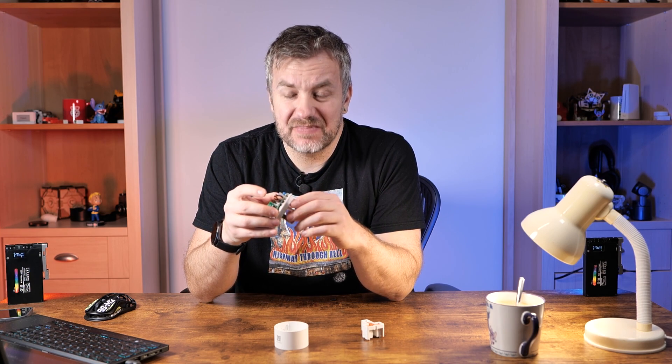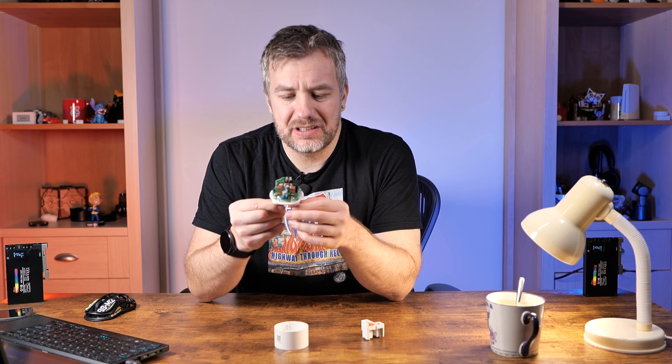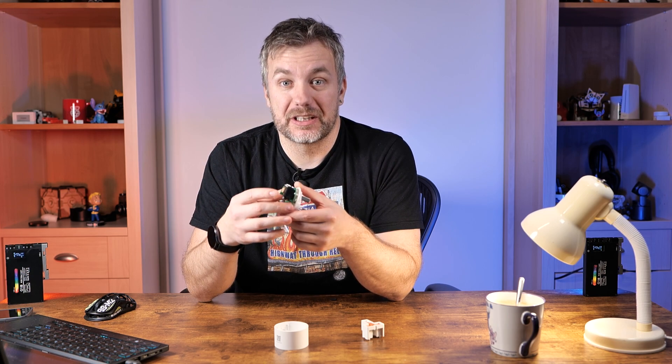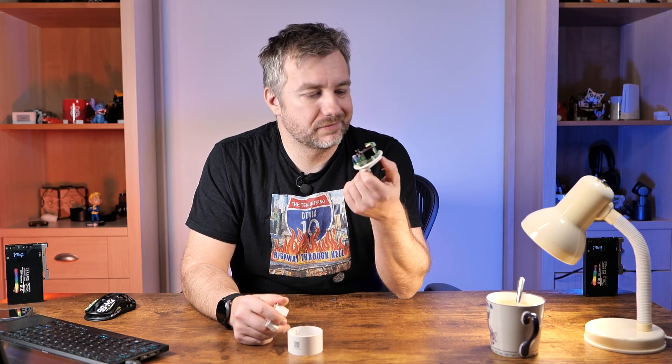It's not difficult to perform, but it's harder than your usual Sonoff flash, and I don't know if there's a point — especially when you can find something on the market that might be slightly more expensive but much easier to flash with Tasmota firmware. So I'm raising my hand and recommending this plug if you're looking for something that works with eWeLink and won't break your bank — it's a really good choice. However, if you were planning on flashing this and integrating it with something like Home Assistant or Tasmota directly rather than through skill integration, then you're going to have some problems.